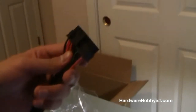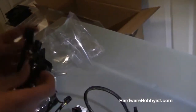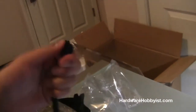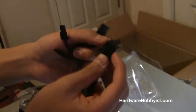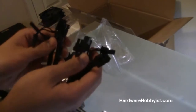Some key connections you want: the 24-pin motherboard connector — a lot of times it's 20+4, as it is in this case. Every modern motherboard will have the 24-pin. Right here you have your PCIe Express connections, basically for your graphics cards. This is the 8-pin for the CPU motherboard, providing extra power for the CPU. And these are the PCIe Express graphics card connectors — these are 6+2 pins, so for all your latest and greatest graphics cards, these will definitely be able to give enough power. These just plug directly into your graphics card.